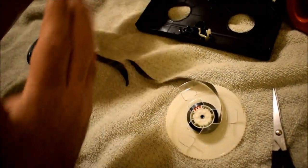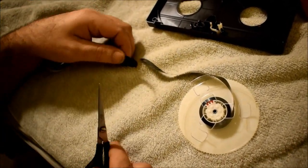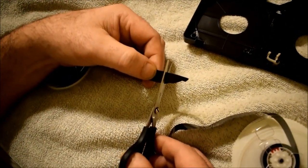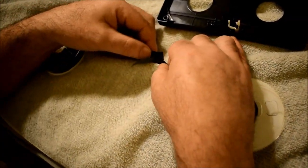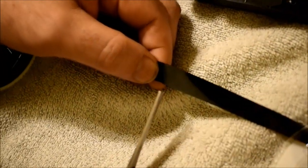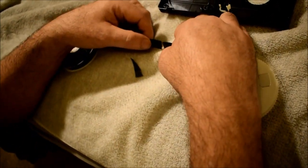Realistically in this tape I might miss a second or two of the film — I've never even watched this particular tape. First thing I want to do is cut this ribbon as square as I possibly can — it'll never be perfect but I'll cut it as square as I can. Another way: put both pieces of ribbon together, lay them flat as can be, and cut them both at once so you get two square cuts that fit perfectly together — like cutting two pieces of wood on top of each other.